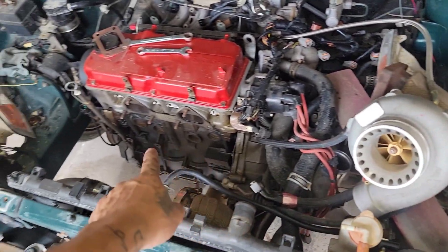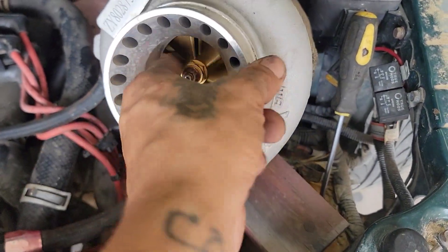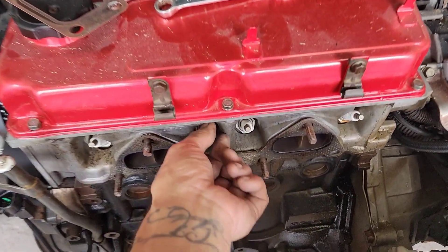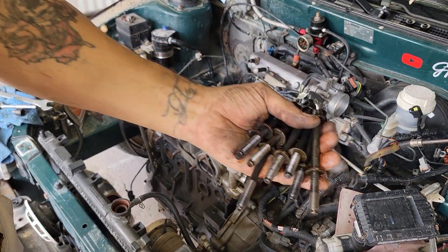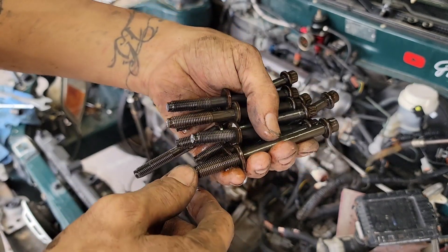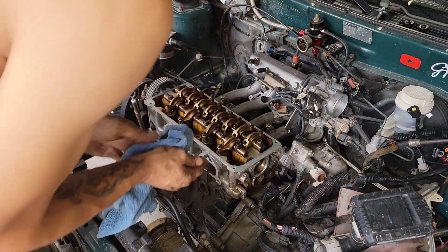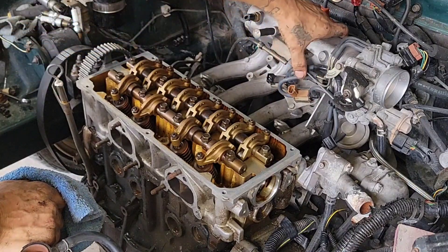At this point I took off the turbo and the manifold, unplugged the drain. I kept the water lines and the oil feed hooked up to the turbo. It's a GT3682 — a 66 millimeter turbo. The spark plugs are loose like I said. I removed the valve cover, then removed the head bolts — man, do they stink like old burnt oil. These are a size 10 but they're a 12-point socket and 12-point head. Since this is my first time disassembling this, I'm going to try to lift the head and pull it forward because the intake studs are still there.